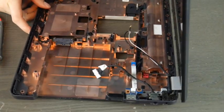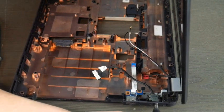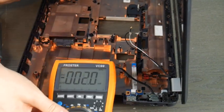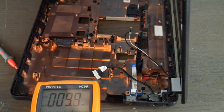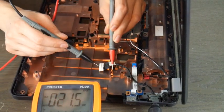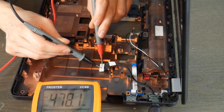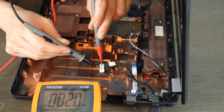Pretty simple — make sure they don't touch so you'll get an accurate read. When you're working with power, you should always be careful because you don't want to get sloppy. I'm going to go ahead and plug it in. Red prong to red prong, and now that I've pulled back the tape, I'll put the black one with the black wires. This will give me a readout as to how much power I'm getting. In this case, I have a working power jack — 18.9, well within the realm of acceptable for this particular computer.